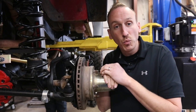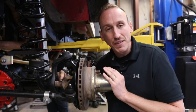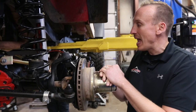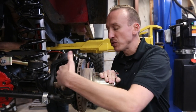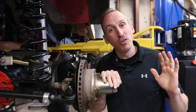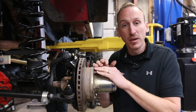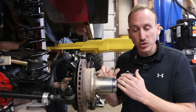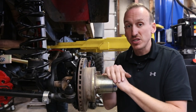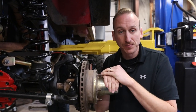It's also pretty neat when you're off-road. We also call this a full float, and that means the axle shaft is not integral to having the wheel and tire stay on. Some vehicles have a C-clip which holds the axle shaft to the wheel, so if you break an axle shaft, out the wheel and tire goes and you are stuck in the middle of the woods with a serious problem. On a vehicle that has a full float hub like this, you can remove the axle shaft and unlock the hub, or even simply unlock the hub, and nothing is going to happen — the axle shaft won't spin. So you can just drive out in two-wheel drive or three-wheel drive if you're able to.